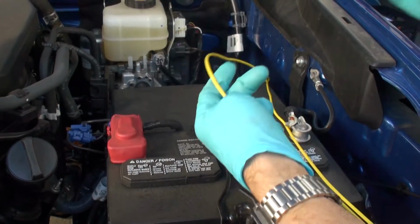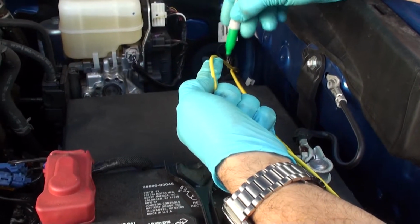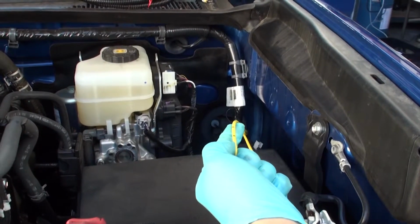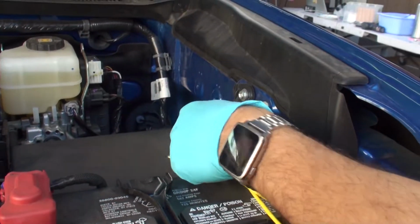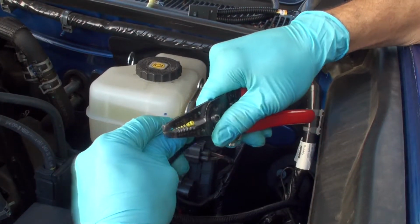If trimming wire slack, we recommend tagging the A wire with a marker to better differentiate which wire is which after the trimming of the wires. It is recommended to run both power wires in the event you ever add our dedicated sub-amplifier option in the future. Use a wire stripper to strip 3/8 of an inch off the end of the power wire.